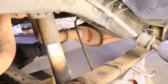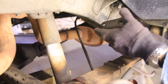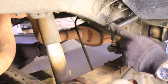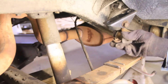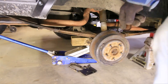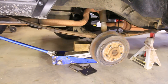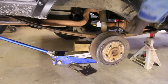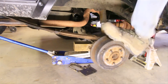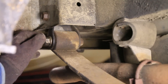Make sure to save that — you can use it as a yard ornament. Also save these hardware pieces that came off; we'll use those in another video soon. When I dropped all that stuff the axle landed on my jack, so I'm just going to let that down and hopefully separate the axle from the leaf spring. There it is — now I've got space to pull it out.